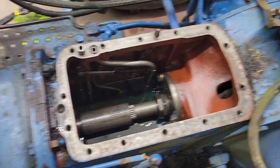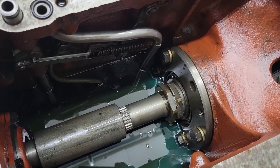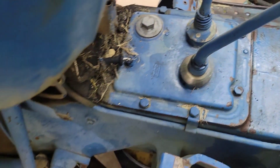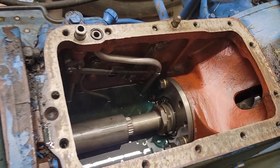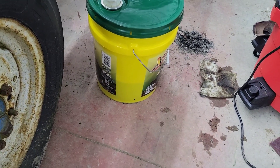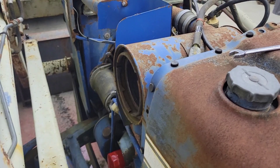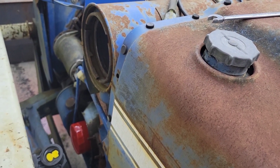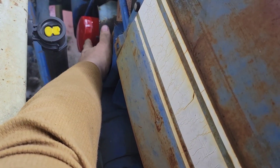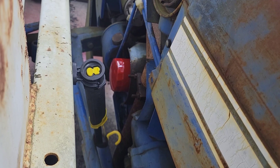About six gallons — it's up to the fill plug right there, started spewing out, so I put the plug back in. This one took around three gallons as well. About three gallons is what the transmission took, and five quarts for the engine oil. The manual said eight quarts, but it's full with five. I went a little bit over full because this filter is a side mount, so it's not full yet. When that filter fills up it should be right at the top of the operating range.